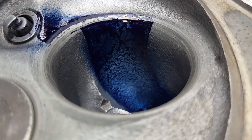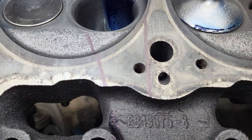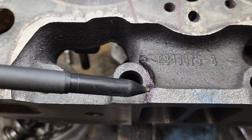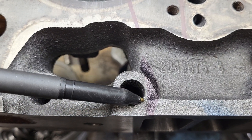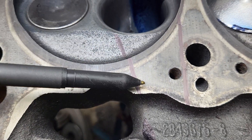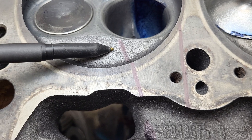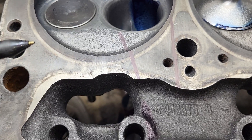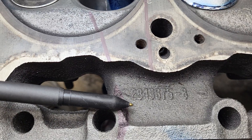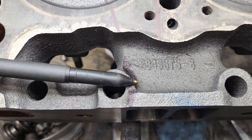Let's grab a magic marker and take a look at this. The magic marker line is hard to see, but we come real close to our pushrod pinch here. This is curved, and it curves all the way along this entire wall to the bowl. It's been extended out about as far as I probably could without worrying about casting thickness. But this little neck-down right here causes very high speed air right at this pushrod pinch, so the texture there makes a big difference.